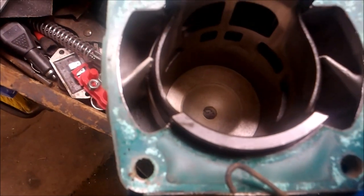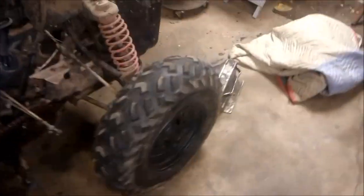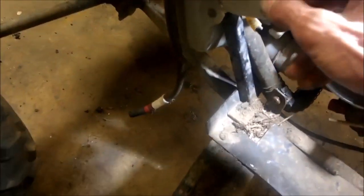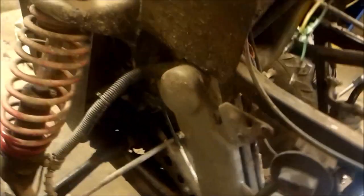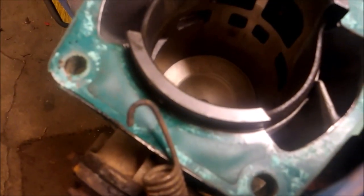So either I got a radiator issue where it was overheating and spitting out through the overflow tank - because I got a crack in mine somewhere. Here it is, here's the crack - it shot out that crack and I didn't have any coolant left in the radiator, so I thought it dumped into the engine. Looks like I might be replacing that radiator. The coolant went all the way through the jug without a drop at the bottom, which means it's sealing good - I did it correctly. So I guess I'll throw the jug back on and try to fire it up and see what happens.